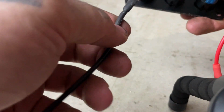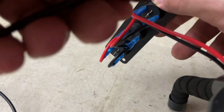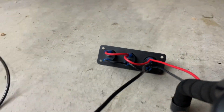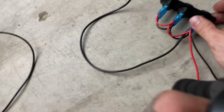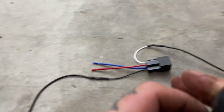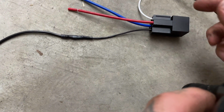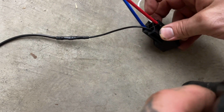Okay. So for switch 1, I'm gonna go ahead and, okay, that's plugged in. And then this is gonna be hooked to ground. So when you press this, it now completes the circuit. And then because you're grounded, it completes the circuit. And then the coil inside is gonna, I think it's an electromagnetic field. And then it's gonna connect these two. So it's gonna connect pin 30 and then 87.